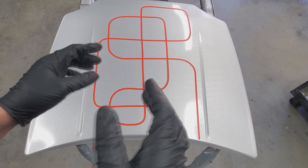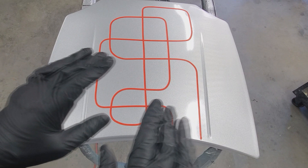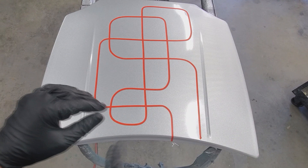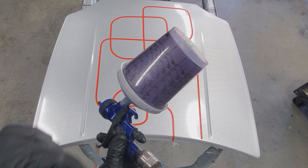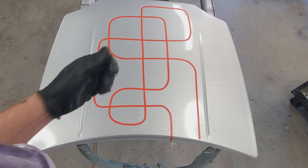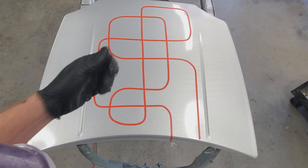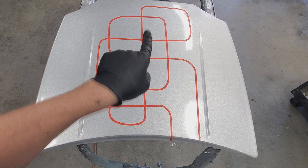This is just a quick little layout I did for you guys. For those who have been doing this, I understand my lines aren't perfect and the curves are different — bear with me, this is showing how to do something, so don't murder me in the comments. We've got all this laid out with FBS fine line. What we're going to do is take a contrasting color — in this case the SATA 1500 with a little bit of purple I've got made up from some spare colors — and we're basically going to follow the tape, shadow straight directly on top of it, and that's going to give us our design. After that we'll come back, untape all of that, and you'll see what I mean by the never-ending line. Then we're going to show how to make it look like it's going up and over every single one of these intersections.